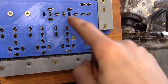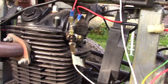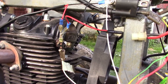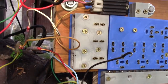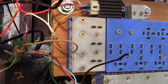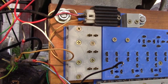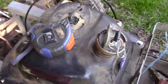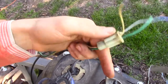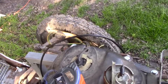I'll need one relay for the lights and one for the cooling fan. Instead of a button, we'll use a thermostat to turn the fans on. The connectors at the side can be used for small things like indicator lights and especially the petrol gauge. I've got this fuel tank from a scooter with an incorporated floater, and I could find the plug that fits in there. Now I just have to find the gauge itself.